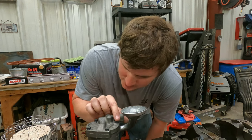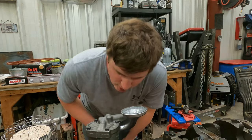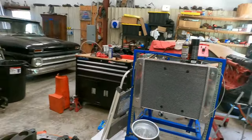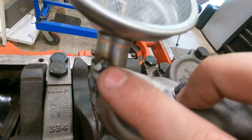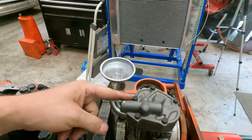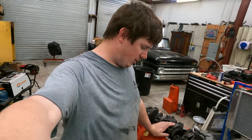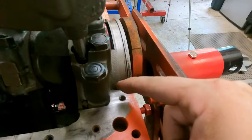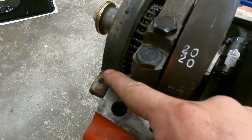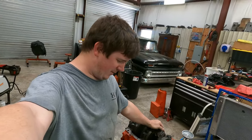I'm going to take it just a hair down from there and debate putting a brace on it. It's a little loose, so let's see what I can do. We busted out the welder and welded everything up — spot weld here, spot weld there, and a spot weld there. That keeps this guy nice and firm, keeps it from pulling out, and you bolt it right here. That tube is not going nowhere — good and firm and solid. What's left is to put the oil pan on. When I do, I'll put a big glob of silicone in all four corners and across the very front because it always tends to leak there. Then the bottom end will be all tied up and done.